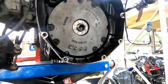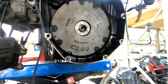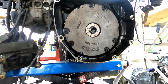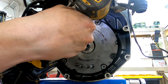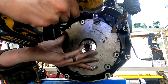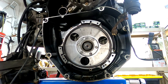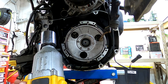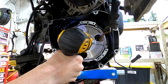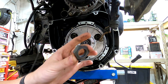All these six millimeter bolts around the clutch plate — undo all of them. Now we need to take this big nut off in the center that bolts to the crankshaft. In order to do that, use an impact with a 30 millimeter socket — just like that.